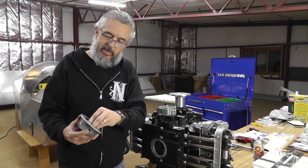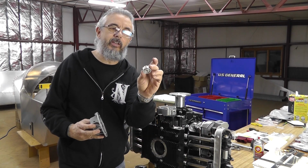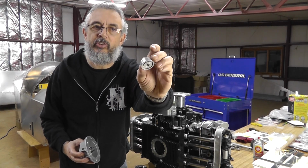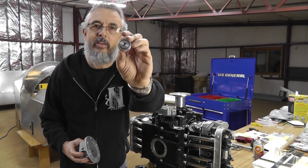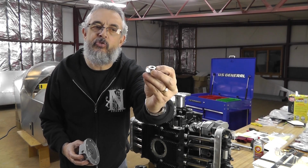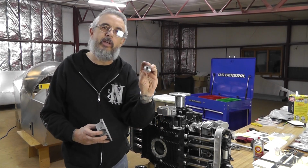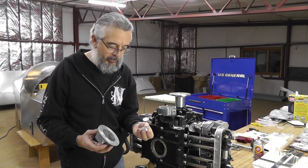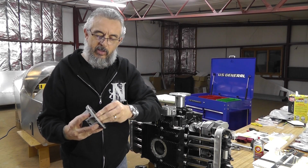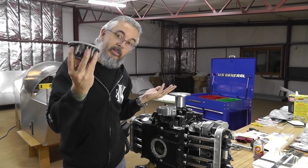There's a spring for pressure that sits really snugly over the boss in the bottom of the sump. Then there's the pressure relief valve, which is a small aluminum cylindrical device that has a ball in it with a spring behind the ball. I know you can't see this, but there's a driven pin going across the cavity, keeping pressure on the ball. And I'm sure that spring is pressure rated to release at a certain point. But there's a groove around the large face of this that fits right into the diameter of that spring perfectly. So that's it. That part's ready to go.